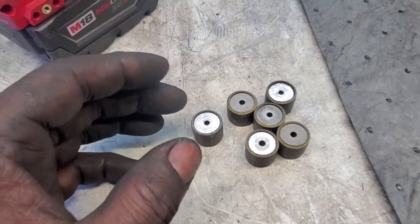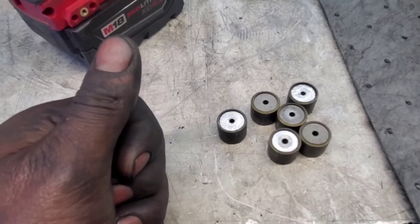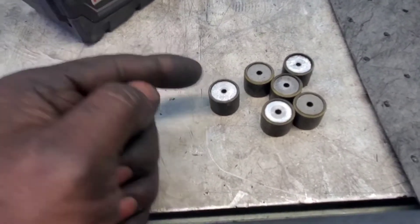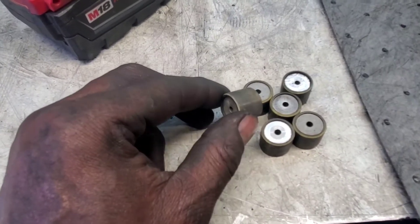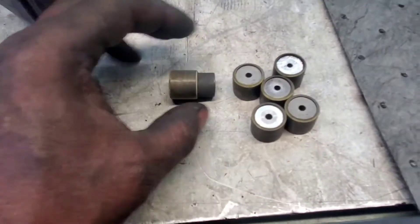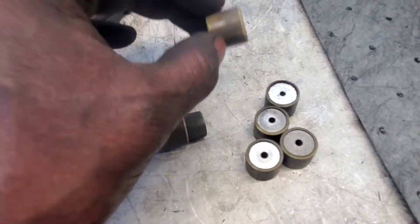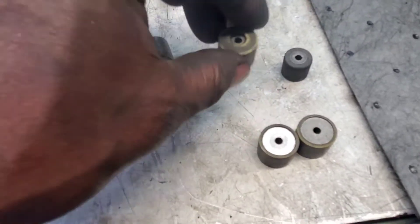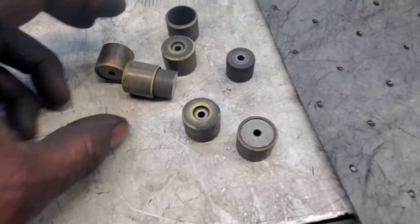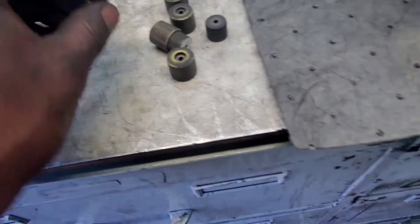So that's, in my opinion, three things that are wrong. You've got bad vacuum hoses, you've got a fussy automatic choke, plus you've got these rollers. The scooter is trying its hardest to get you where it needs to go, but it just couldn't do it. Because one or more of these rollers — this one's loose too, I can feel it knocking around in there. This one here is definitely loose. This one here is knocking around. This one is knocking around. And this one's okay.